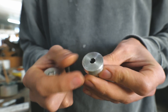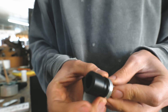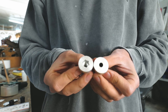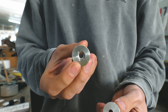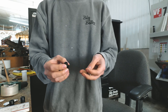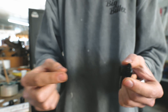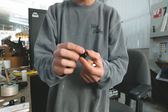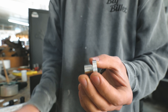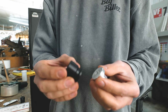I still have to put the hex in there — you can see there's some chatter on the parts. In the end it all gets covered up by the slider so you don't see it anyway, but I have to machine the hex and internal threads in there. These are the fronts. This replaces the stock axle cap on the hollow axle — I've got a threaded insert that's your hex to tighten it down, and then you can bolt to it.